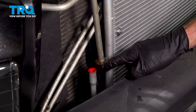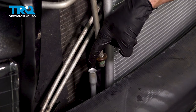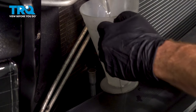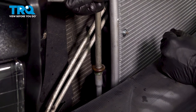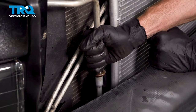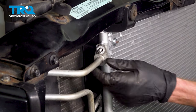Now that we've replaced all the gaskets, we'll continue on by opening up the lower port — there's just a little plug in here. Continue on by adding one ounce of PAG oil directly into this port. Now that we've added our PAG oil, we'll continue on by reinserting the line. Press it down and listen for a click. Once you've done that, take hold of it and try lifting it up to make sure it's secure. Now that we have the lower line in, let's continue on up along the top and put it in position, sliding it directly into the AC condenser.